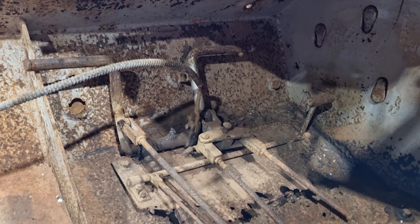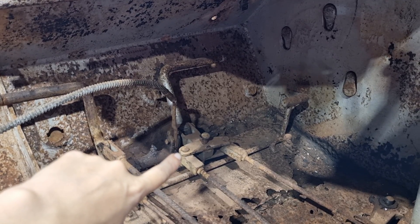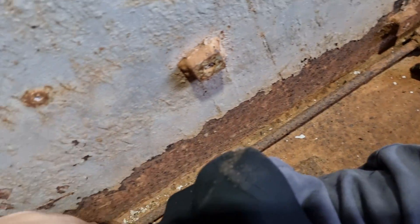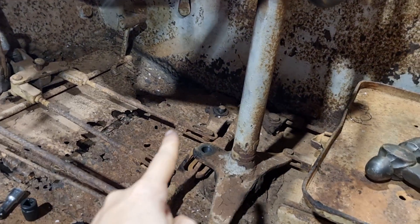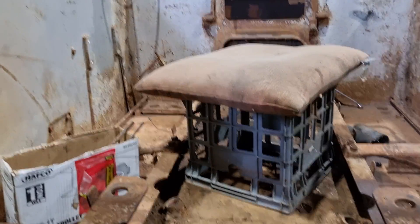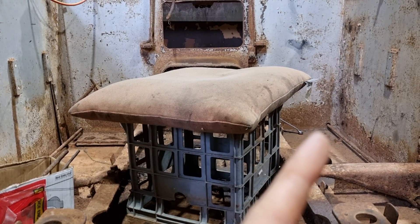The brake — this is where things get a little more complicated. This is our brake pedal in the middle. It connects to these two bell cranks — that's important, we'll get to that in a second — and it pushes these bell cranks forward and back. You'll notice that there are two of them. One of them comes down here under my other knee to this bell crank and to this rod here, which goes behind me. The other one goes off to that side, pretty much the exact same setup, to the far side. Now these two go all the way back to the brake drums — there's one there, and there's the other one over there. So that's pretty straightforward — all the brake does is just push them on and off.